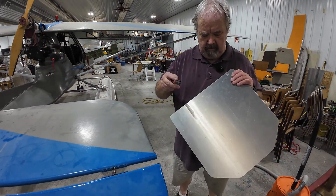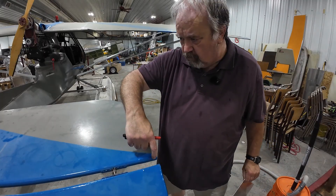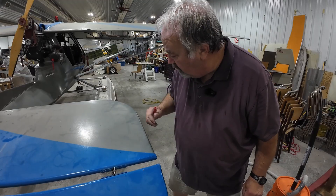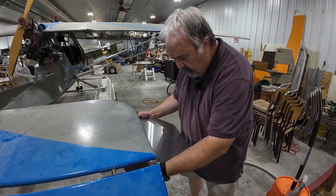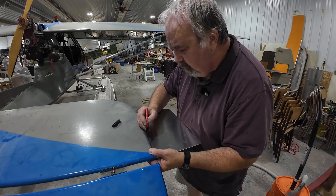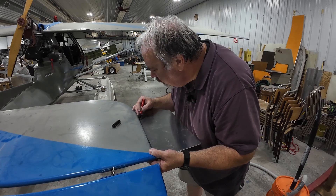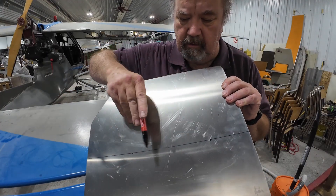Where do I want to mount or drill my two holes? At the trailing edge of this piece there's a strapping with some rivets you can see underneath the cloth, so I need to be forward of that. Then there's the curve of the tube — I don't want to mount it on the curve, I want it where it's flat. I'll lay this up here, spot where that is, and put my rear mounting point right here. Mark that. There's a nice flat section at the front — mark that. There are the two marks.